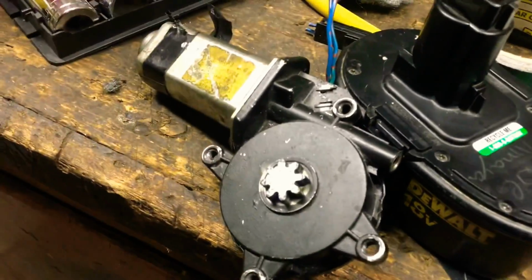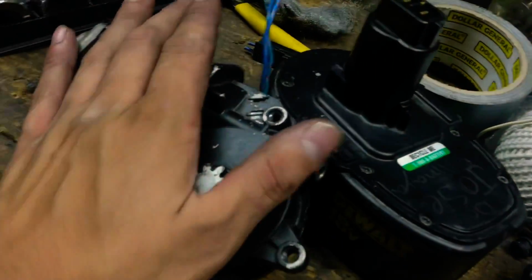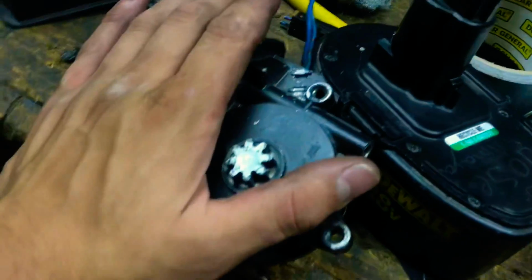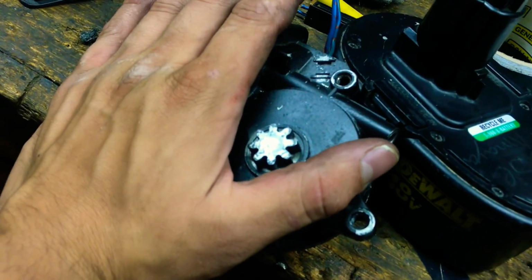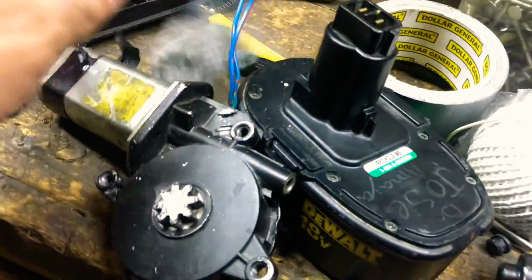This whole time I literally thought it was my amp, and it wasn't. It was actually these. They're old, they're brittle. Be careful with them, you know. And if the contacts are bad, put some steel wool and you should be good to go.